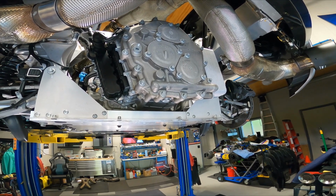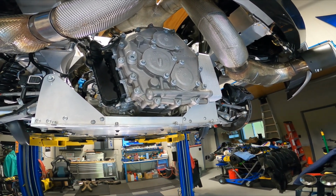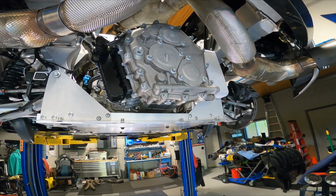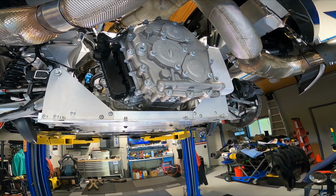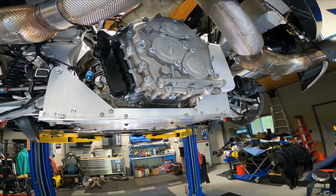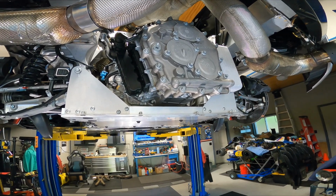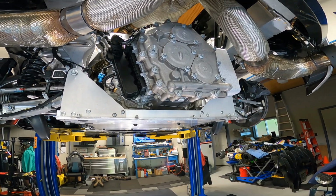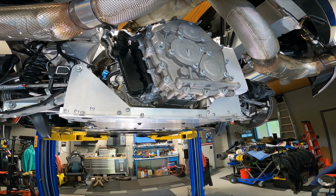The other issue is this is a track pack car that has the telemetry app, but you can't write to a USB drive, and I think it's just the owner's manual was not updated. I think what we've discovered, and I've sent emails to McLaren in England to technical support and still heard nothing back over months. Also contacted the customer relations person for the US, which was supposed to look into it. I think the issue is, unless you have a V-Box, which when this first came out, the track pack cars, it wasn't available, but unless you have a V-Box, that's what's basically collecting all the data, both video and telemetry, probably off the CAN bus, and that writes to a USB.